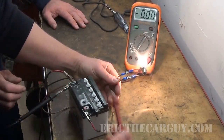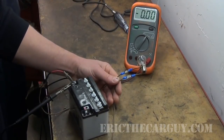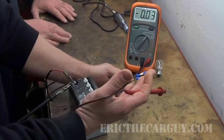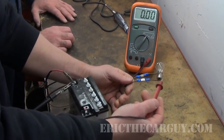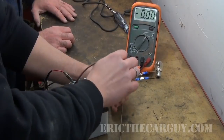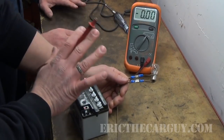And if this was a computer-controlled circuit, I would call that a control wire. So now let's make this positive side switched. If we're positive side switched, what would we expect to see in the same situation? Well, it's completely opposite. Leading into this — we leave the component plugged in and we back-probe it carefully. A little warning here: we never want to use two T-pins at the same time, because if they would touch each other and this was a computer-controlled circuit, bad things can happen. So one at a time please — total short circuit.